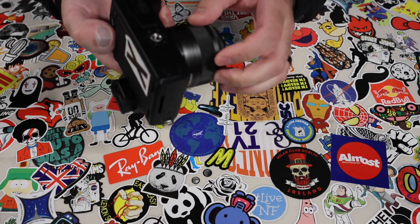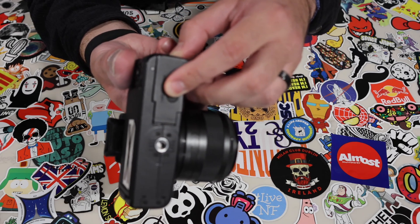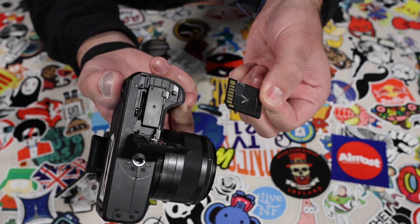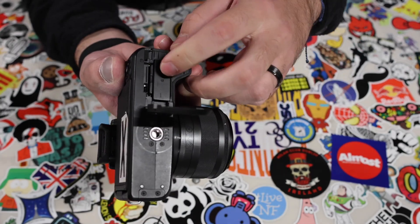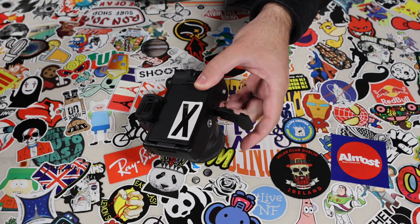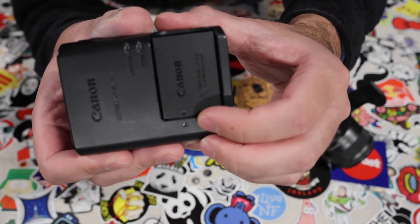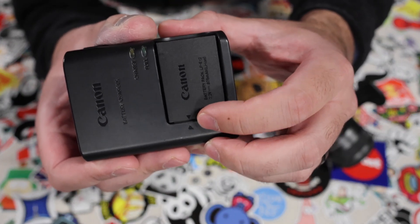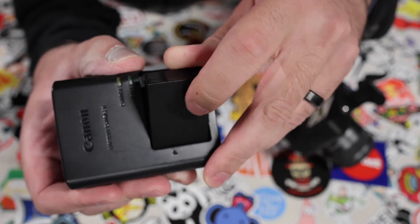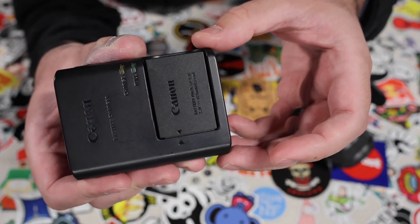On the M50, the battery and SD card are in the same spot on the underside of the camera. There's a switch — press down and slide it forward and it'll pop open. The SD card lives here; just take it out and put it back in. There's a little lever to take out the battery. The charger looks like this — there are two arrows that help you connect it. The two arrows need to be facing the same way and touching each other for it to charge. Press the bottom back and it'll come out; slide the top part down and click it in. The charge light will light up when it's in the right spot.